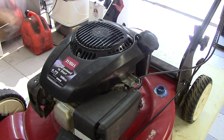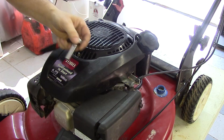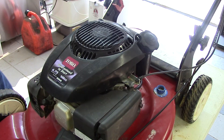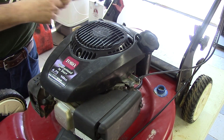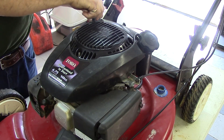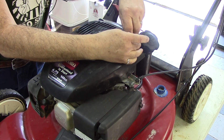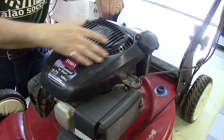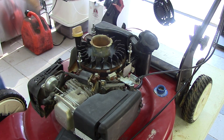I've got a 10 millimeter socket to carefully take off our recoil bolts — or nuts, I guess you would call them. I just got a set of quarter-inch drive metric deep sockets, ten bucks at Tractor Supply. For the kind of work I do on lawnmowers, that's gonna be good enough. I don't feel the need to buy super expensive stuff. So it's these three nuts that hold down both the recoil starter and the shroud. Move them out of the way and the recoil comes off. And we just gently lift the shroud. Now we've got access to what we need to see.